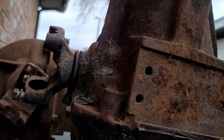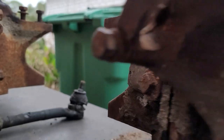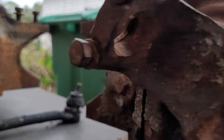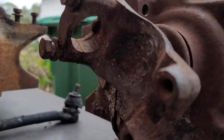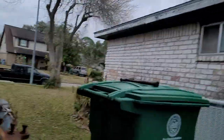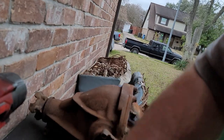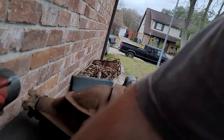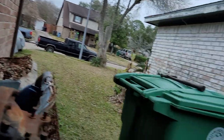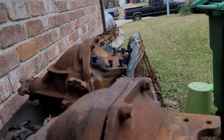This stamping is consistent on all years from 1963 up. Even the C4s have the differential code, though on C4s it's laser etched into the bottom rather than stamped. You can also see the part number on the main case up front. We're going to go ahead and take the rear cover off so we can look at the inside.